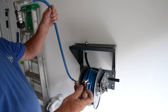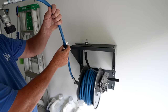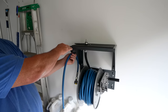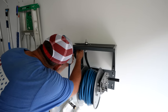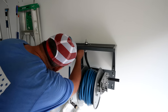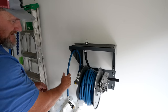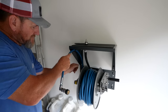Take your jumper hose - we supply these little stainless steel clamps. The clamp goes around the jumper hose, then take your washer and nut and go up under the shelf and put that on the stud that's already in the metal, so you don't have a bolt sticking out the side of the pressure washer shelf. This is a little bit tricky to get installed but once you install it, it's there and it's a done deal. Do not tighten it all the way yet - you need to be able to slide this hose through a little bit. We'll get to that in a minute. Let's put the pressure washer on.